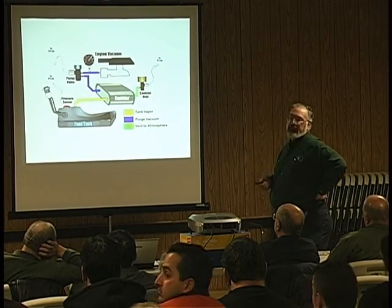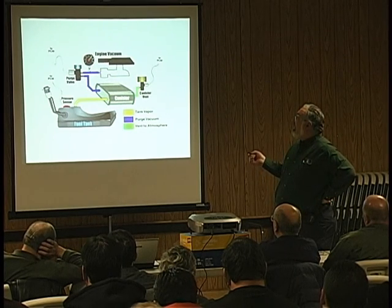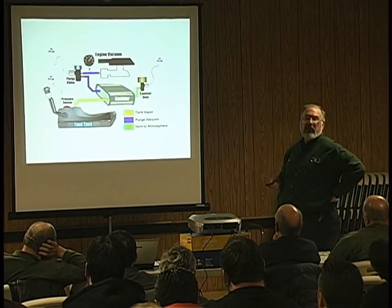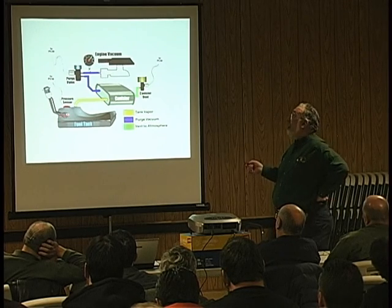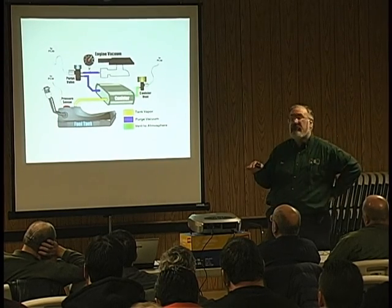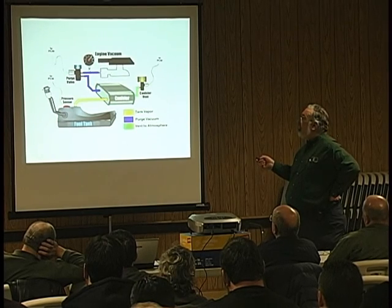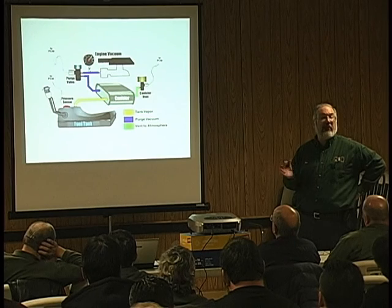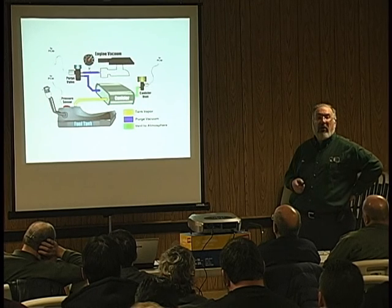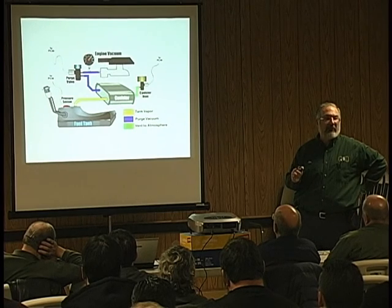So I went to the pressure sensor next, checked it just like a MAP sensor. And when I had the system vacuum going into the canister, I had the vent closed, which is normally closed anyway. The pressure sensor didn't do anything, just stayed flatline all the time. Didn't register at all. So I was putting vacuum directly to the canister, but the pressure sensor wasn't doing anything. I said, oh, it must be a bad pressure sensor. I took the gas tank down, and sure enough, the pressure sensor is brand new. Brand new.